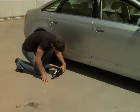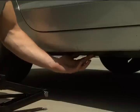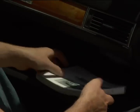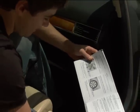Step 3: Place the jack under the car's frame nearest the wheel to be jacked up. There's a thin lip that runs along the side of your car — this is where the jack should go. Your owner's manual will have a picture of the safest place to put the jack. Bumper jacks will attach to slots in the front or rear bumper on older cars.